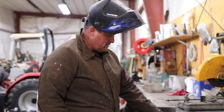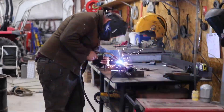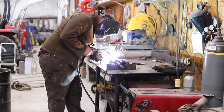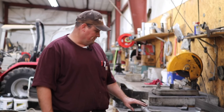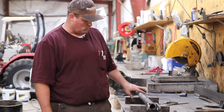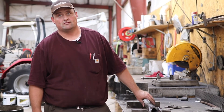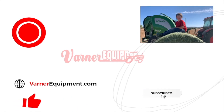We've got it set up over here on some V-blocks, and we're going to go ahead and weld that all up. That's the full deal on that — it's all welded back together now and we're straight. For this customer who needed 23 inches, that cuts it out and puts it right in. So if you have to do a repair on a domestic driveline like that — a round-style driveline with a square input on the inside — that's what you're into for doing one of these. I'm Devin Varner from Varner Equipment in Delta, Colorado. You can call us at 970-874-0612, or our website is VarnerEquipment.com. For videos like this, make sure to subscribe.